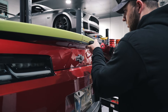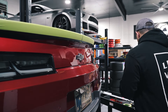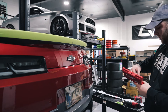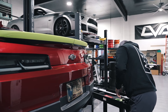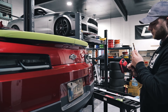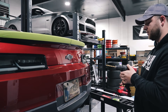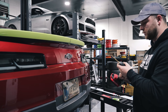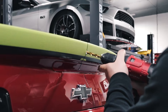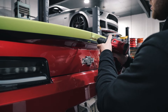You might get some burrs — you can kind of go in there and clean them out. Now I'm going to move on to the final drill bit, which for reiteration purposes is going to be 9 millimeters, or in our case the 23/64. It doesn't require special bits — we're using carbide, but anything that'll go through a mild plastic is going to be just fine. Let's open it up to the final size at slow speed. Sometimes I like to throw it in reverse before pulling it out just to ensure all of those burrs are pulled out. Now we've got enough room to insert our first rivnut.